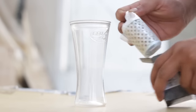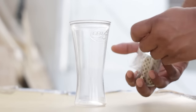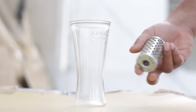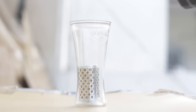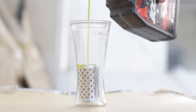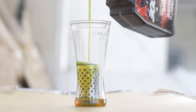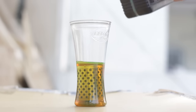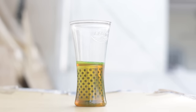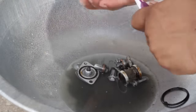Take out all the parts and take them for cleaning. You will need to buy a new oil filter, which has to be changed every time the oil is changed. It cannot be put directly into the oil filter case — it has to be first soaked in oil. Put the oil filter in a vessel and fill it up to the brim with new engine oil. Do not use used engine oil. Let it soak for some time and keep it aside for later use.